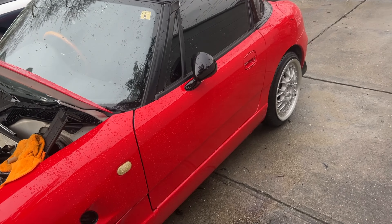I got seven out of eight bolts out - the difficult one is right there. From what I've seen, a lot of people had to remove this entire piece and rotate it to get access to that bolt. It looks like mine was already broken, so let's see if I can just take this off. That actually wasn't too bad since mine was already broken - all I did was remove that 10mm bolt, lift it off, and boom - we've got access to the spark plugs. This area also looks really gunky; I'm going to clean it up a bit.